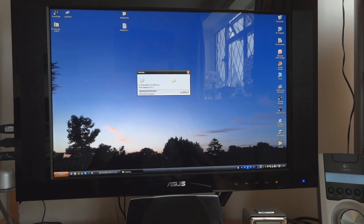What we're going to do in recovery is we're going to do a factory reset, wipe the cache and the Dalvik cache as well so that we get a nice clean install. Also make sure if you are coming from another ROM — for example if you're on Darkies ROM or anything like that — make sure you disable lag fix before you flash.